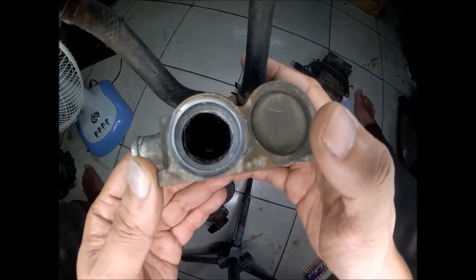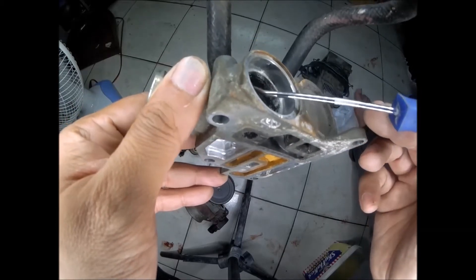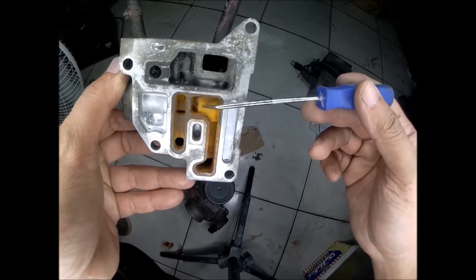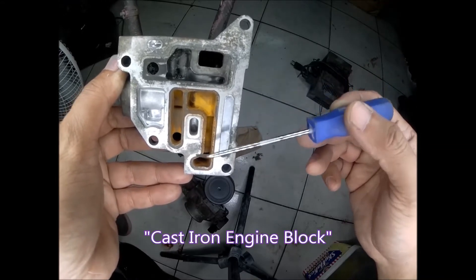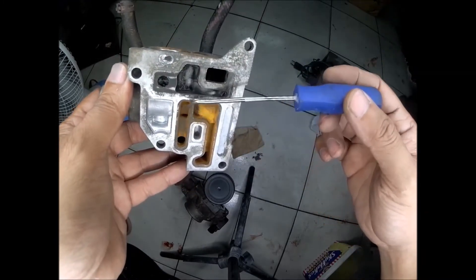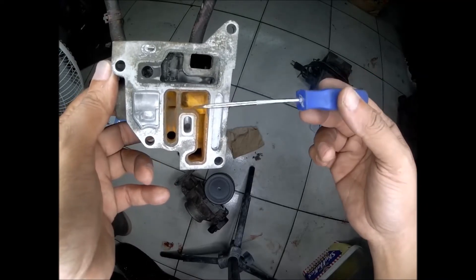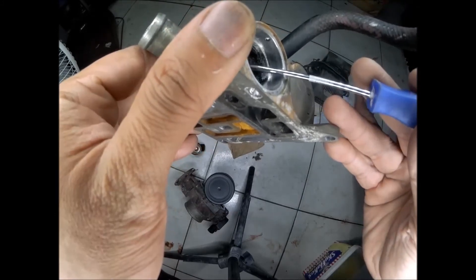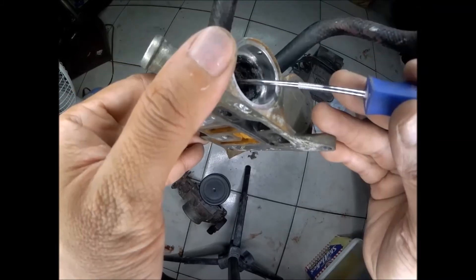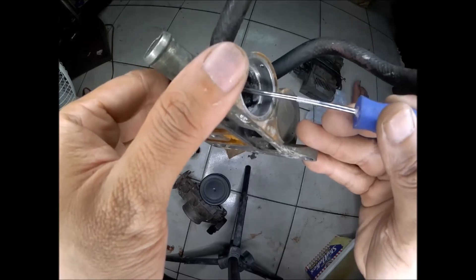As you can see, it is very corroded. Remember that corrosion in aluminum is whitish in color, not reddish. This reddish color is just contamination from the engine block because these two ports are coolant ports coming from the engine — it circulates coolant through these ports. There is no reddish or orange corrosion in aluminum; this is just contamination. The rubber part is already broken, and under the rubber where it sits there is clearly corrosion underneath, meaning the rubber has lost its adhesion to the aluminum surface. This idle valve cannot be used anymore.